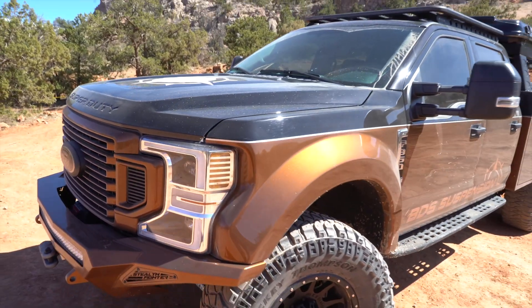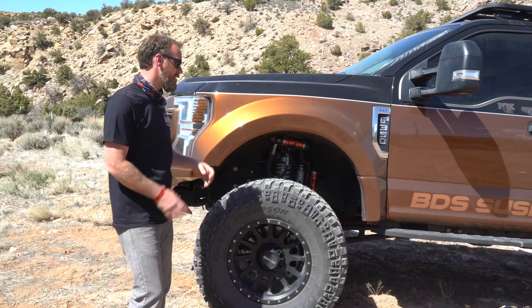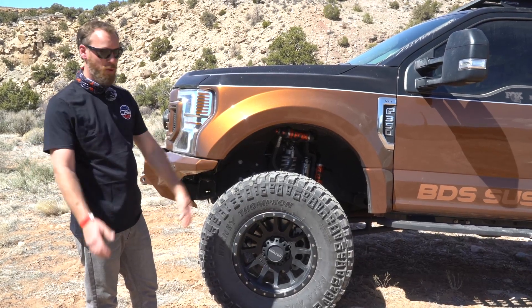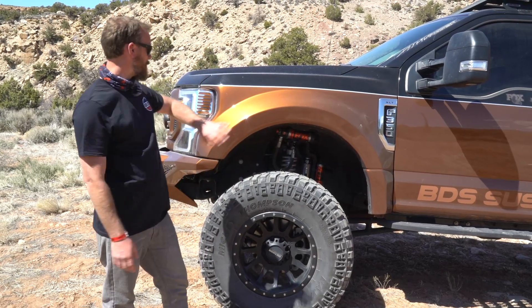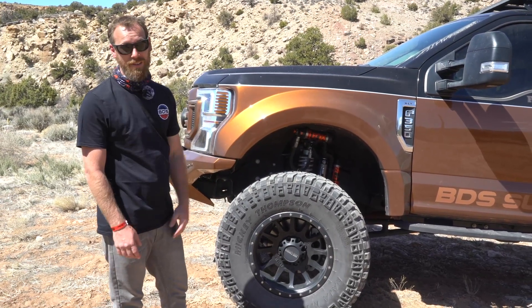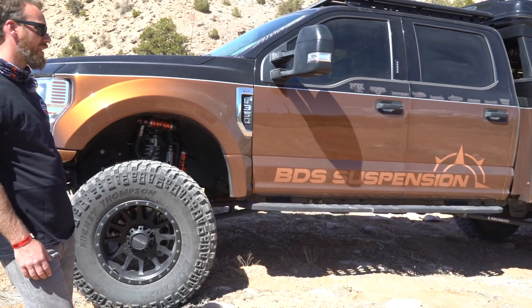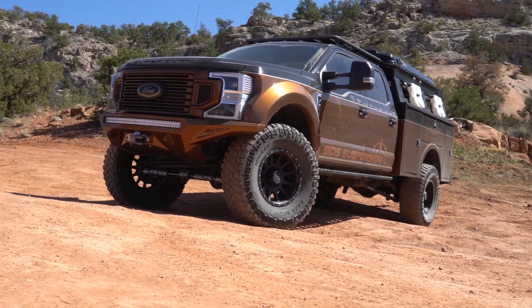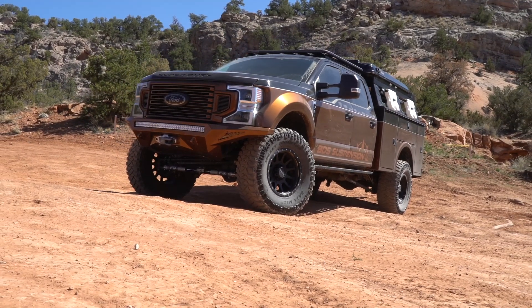To fit these 40s along with that lift kit, we have these right here — the Fiberworks fiberglass fenders. They have a much larger bulge: it's a 4-inch bulge out from the truck to fit a bigger wheel and tire setup, along with a much bigger opening. Super clean — gives us clearance for 40-inch tires. I love how we finished this truck off. It's got the Chroma Copper Elite paint along with Factory Black with a silver pinstripe. Just a clean, understated, earth-tone look ready for overlanding.